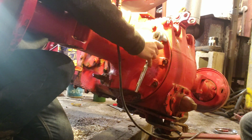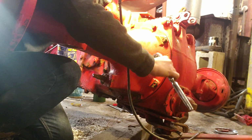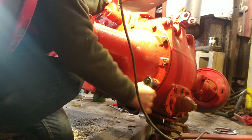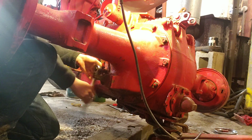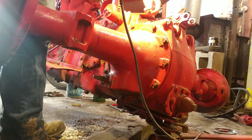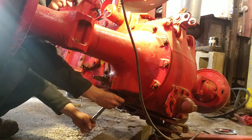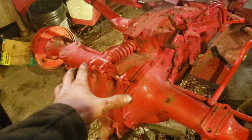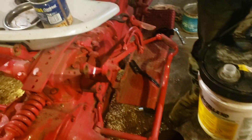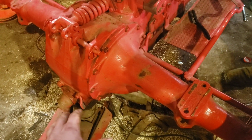Alright, guys, so we're back. We've already got all these hand tightened on here. So we're going to tighten them kind of like in a star pattern since it's a brand new gasket. Guys, so we've got the seals replaced on both sides. We've got every nut torqued to spec. And Jared's got his rear end fluid. We're going to dump it in and make sure nothing obviously is leaking below. And then we can go ahead and put everything back on and start working on the wiring.